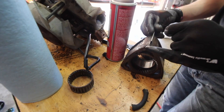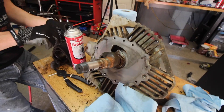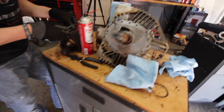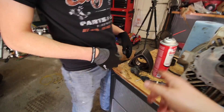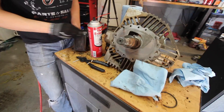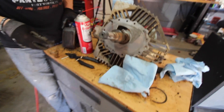Right now we're taking out the apex seals and cleaning everything out really well. I found there's a Sachs 303 motor that was on snowmobiles — very similar to this — and it has a write-up about the proper procedure for installing the rotor, so we can go through that. We're using some steel wool to brush up the ends. The surfaces look pretty smooth; I think we'll just wipe them down with a paper towel to get them clean.